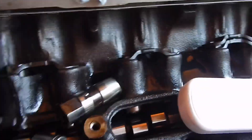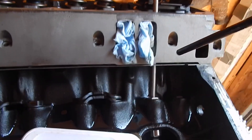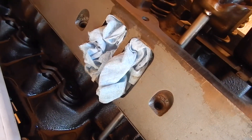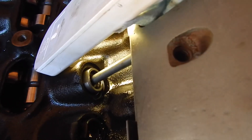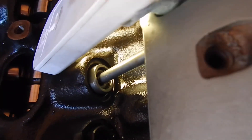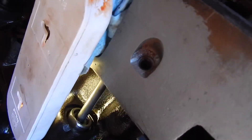Here's what they are — they've got to be the Magnums. The Magnums do oil through the pushrod, so you've got to have the oil-through pushrod and obviously the oil-through lifter. I'm just going to snug this down and watch that plunger go in. That was probably at least 30 thousandths of movement there, so that's going to be fine. I'm going to roll with that — it moved at least a tight spark plug gap, 30 to 35 thousandths.